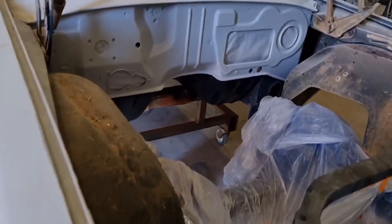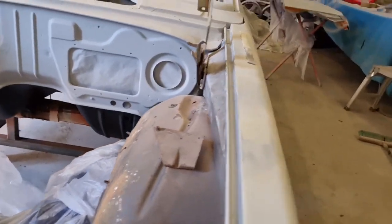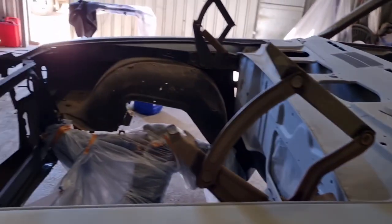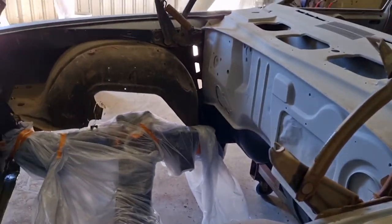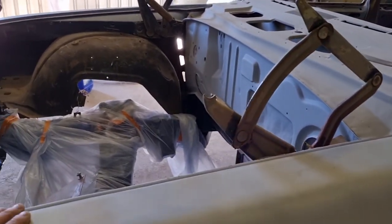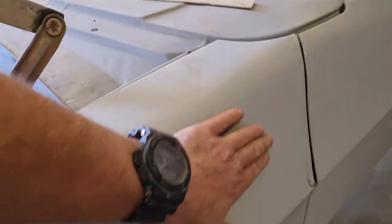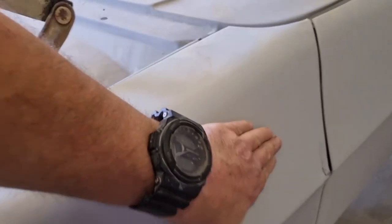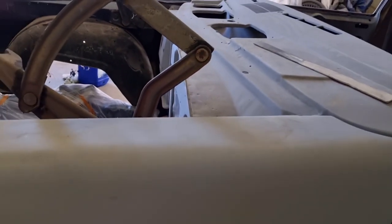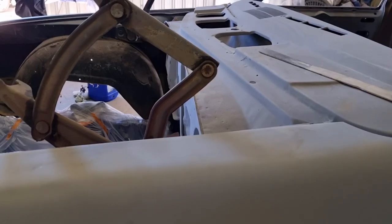Not only that, but we noticed on the one tunnel we just done, the same issue we had with Brother's HX ute, the orange ute we did. Once we bolted all the guards up and put all the inner guards in and tightened it all up, we got a low spot just here. It just dipped in, just like this. On both sides on Brother's ute, Trev can testify to this, he went over and over this about three times trying to get that right and repainting that guard on the ute, and we couldn't work out why.